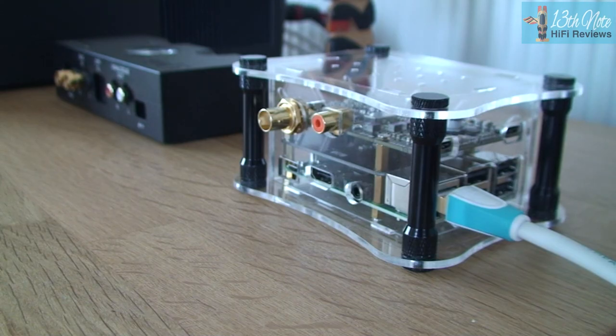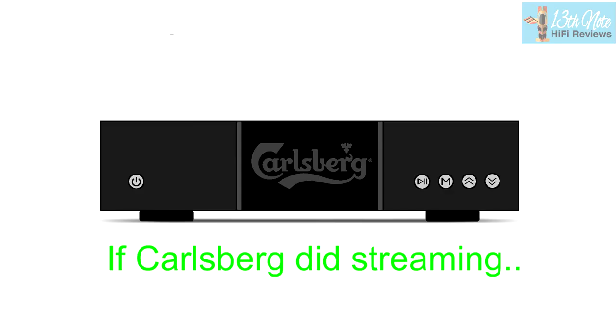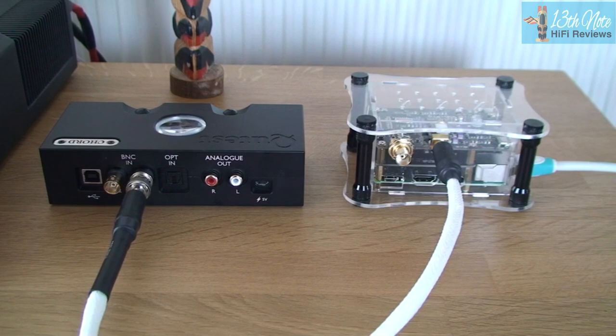What you tend to find is that some audiophiles will diss streaming because they're using a streamer that doesn't have a very good DAC and their CD player tends to have a DAC that's better integrated. So their opinion then becomes all streamers or streaming isn't very good. So my recommendation is therefore that if you want to get into streaming, don't go out and buy a really expensive streamer and route it into a modest DAC. Get yourself something like an Allo DigiOne Signature and route it into a much better DAC and you'll get so much better sound quality and performance.